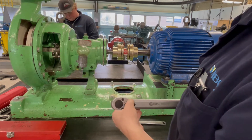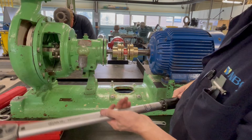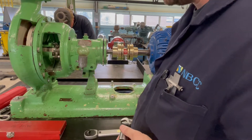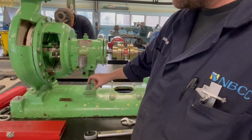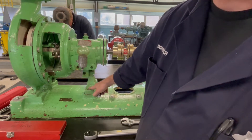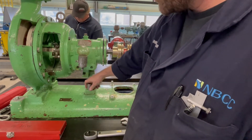I always imagine that the reverse is for left-handed threads, which you can find from time to time. So how this works: we're going to torque this fastener right here — this is a half-inch fastener. If you're ever unsure, a three-quarter-inch socket fits on its head. The socket size is 1.5 times the major diameter of the threads, so half-inch times 1.5 equals three-quarter inch.